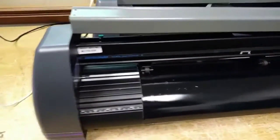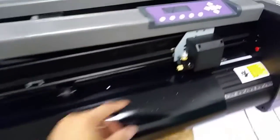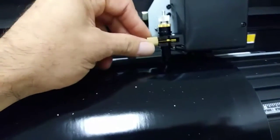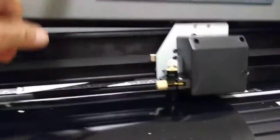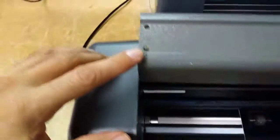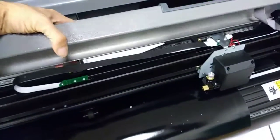This is the image cutter, and one thing I wanted to show you — I've already got it ready. What was happening is that the carriage arm was not moving up and down to be able to cut the vinyl. I noticed that, and one thing I checked was underneath this top rail here. I went ahead and undid the screws on the right and over here on the left. What you'll have to do is just pull this up.